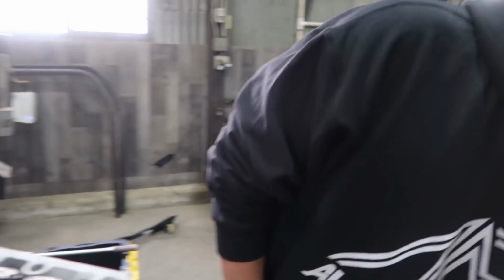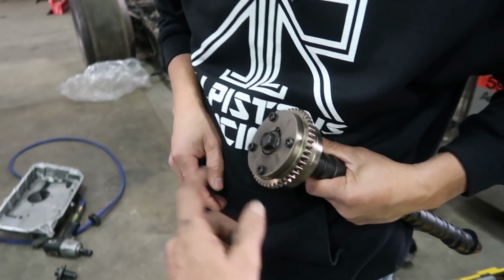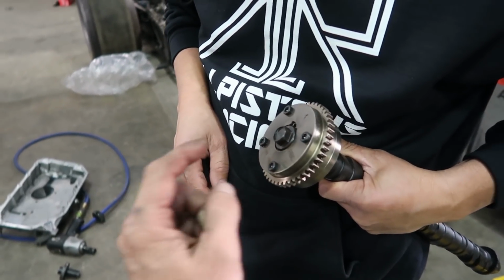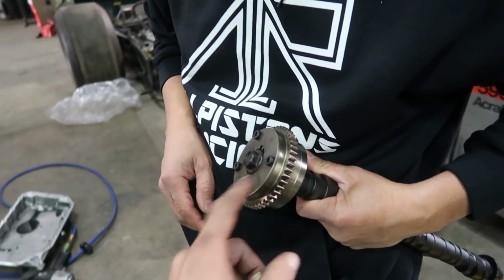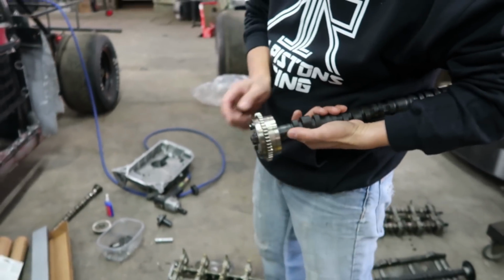And that's it. Because the other one's 25, the RBB. That's the RB. So there's different VTC gears. This one's an RBC, and then there's an RBB. The RBC is the one you want. It's got more adjustment than the other. The other one gets locked out sooner.